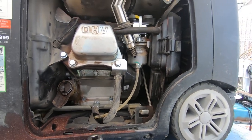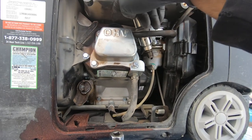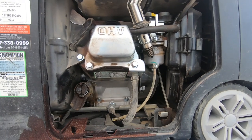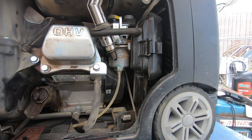So what we're gonna do is one test here real quick. I'm gonna squirt a little bit of gas up there, put everything back together, and if it fires for a couple of seconds then we can go ahead and tear down the carburetor and give it a good clean. Let's go ahead and try that and see what happens.